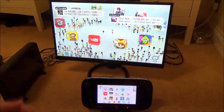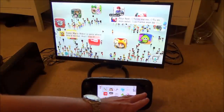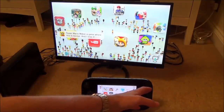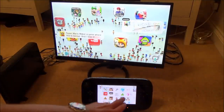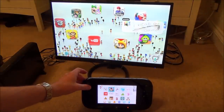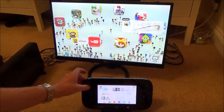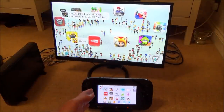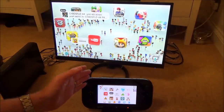Now see if the touchscreen is working. If one of the sticks was off — for example, if you turned on the console when the stick was slightly to the right or left — it might have registered that as the neutral position. That can affect your touchscreen, causing it to drift, because the console thinks that off-center position is neutral when it isn't.